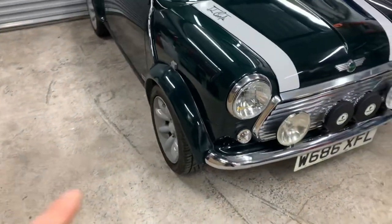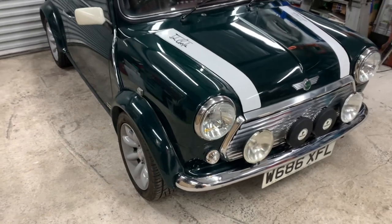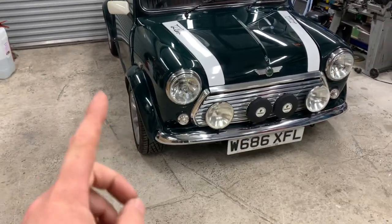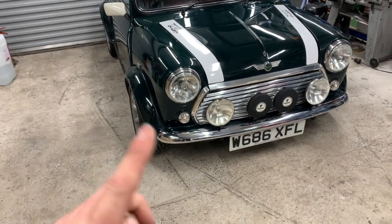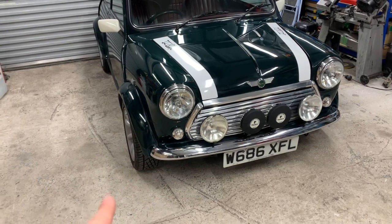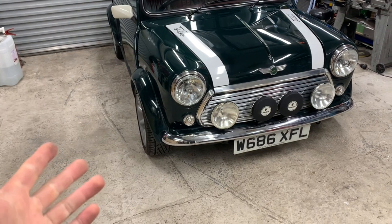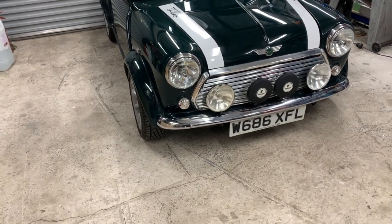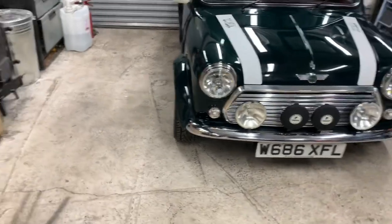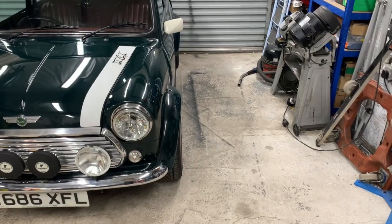What I do know is this wheel has got a lot more camber than the other wheel - always has done since I fitted these bottom arms. So first of all we're going to roll it forward a bit, then we're going to look at our camber and set it. About zero to one degree, nothing more, because it's a road car - you want maximum contact. If you set it to like two and a half degrees on a road car it doesn't need it. I want maximum one degree. That side is a lot more; this side is probably close to where it needs to be.